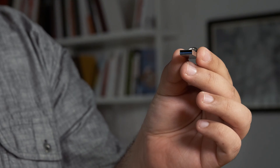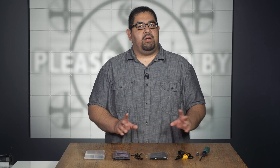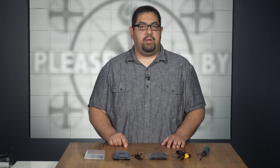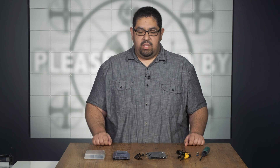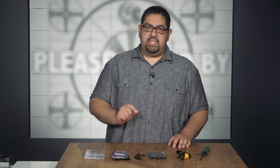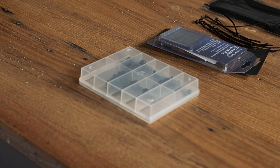You'll also need a USB flash drive with Windows 10 installer on it — I've placed a link to Microsoft's Windows Media Creation Tool in the description below. There are a few other optional tools to consider. I recommend an anti-static wrist strap if you're working on carpet, as electrostatic discharge can damage sensitive components. A good way to discharge yourself if you don't have a strap is by occasionally touching the metal parts of your case. Velcro straps and zip ties can help with cable management. You can also buy your own thermal compound or thermal pads — most CPU coolers come with thermal compound pre-applied. And the last nice-to-have tool is a tray for organization, as there are a lot of screws from various components to keep track of.